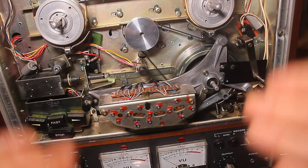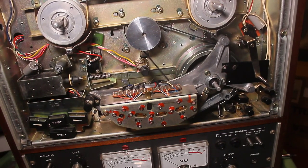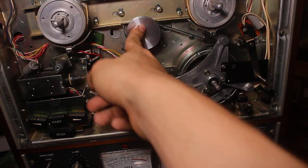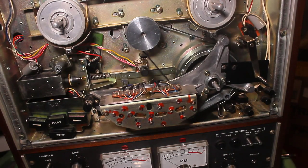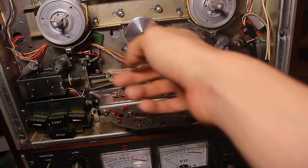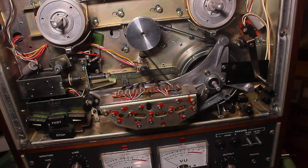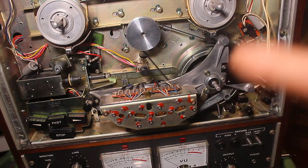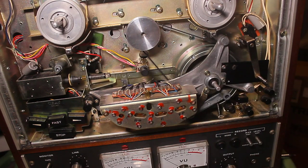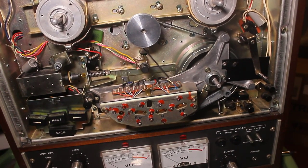We're all back together. I forgot to film the belt installation itself, but the belt is perfectly on, perfectly tight, in the 60Hz slot. One thing to note: there are two different slots on each pulley of different sizes. If you're in a 50Hz country there's an upper and lower side. The instruction manuals for the A model — which has more documentation than this plain 4010 — go into depth on this. Most stuff I found online was for the A4010 but it seems to be the exact same deck with a few more basic things on the amplifier.